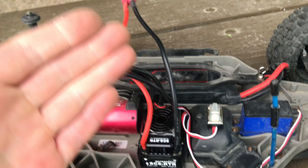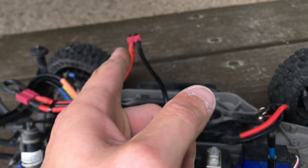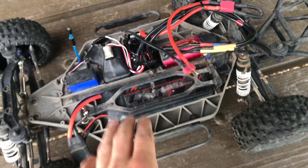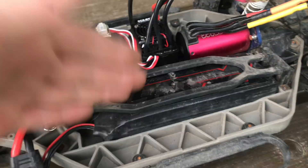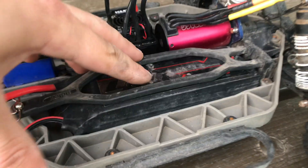When I went fully pinned, this thing was hitting limp mode. But I determined that when I used a 100C discharge rate battery, I wasn't having that issue. I do eventually want to run 4S, but unfortunately today all I have is a 3S pack. And the reason I'm not running 4S is because I can't get a 4S to fit in here.